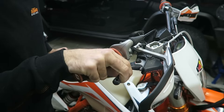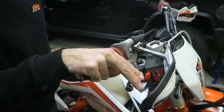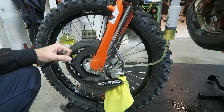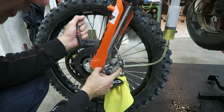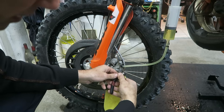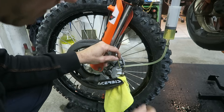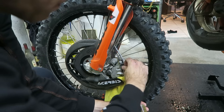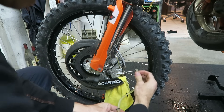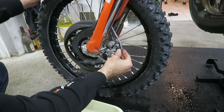Then you can test the brake and make sure it engages correctly and doesn't feel spongy — that feels much much better. Then once you've put enough new brake fluid through the system, you can tighten the bleed valve and remove the hose. Then replace the dust cap.